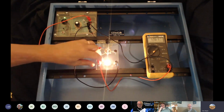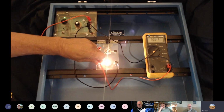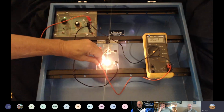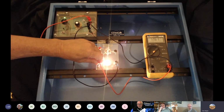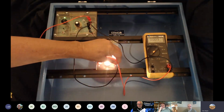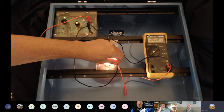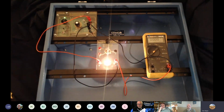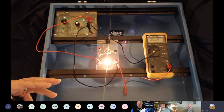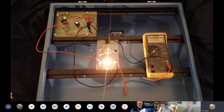So I arrived, and really, if we want to kind of play voltage drop, we can talk. We left at 12.61. We arrived at 12.61. Probably didn't drop anything on this. We're going to go across the load, and we're down to 0. So if there's 0 volts, Jeff, how come the light's even lit? Well, the resolution of your meter is not set fine enough to measure the millivolts that will be dropping on that circuit.